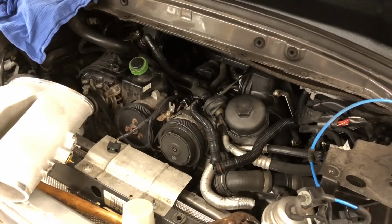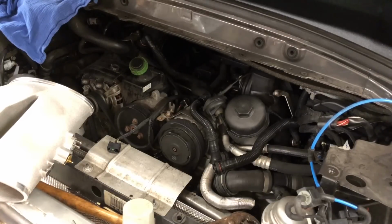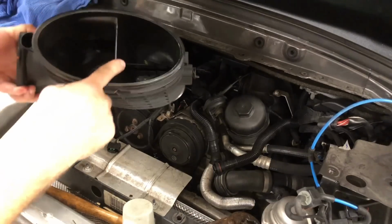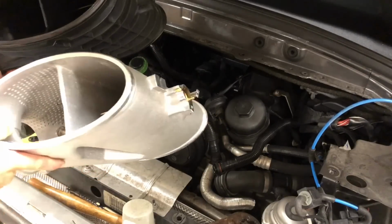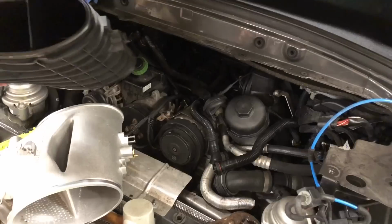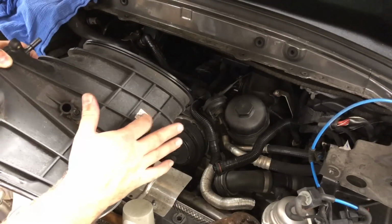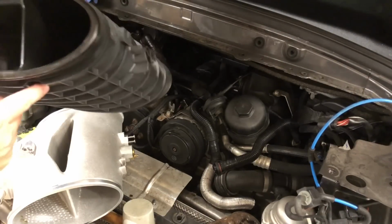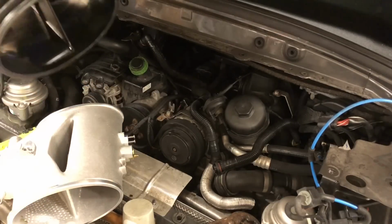Find the Allen key that fits this. You know, just for comparison, while we've got the thing apart, let's take a look before I go shoving it back in there. So this one has a hard wall right here, and the new one has a V'd wall, and it is physically bigger inside. I know you can't really see it, but it's almost like this new plenum comes all the way out to these ribs. So what space they saved with these ribs, the new plenum is taking up that space internally. And honestly, that's the main difference. A little bit larger, made of aluminum, and has an angled feed.